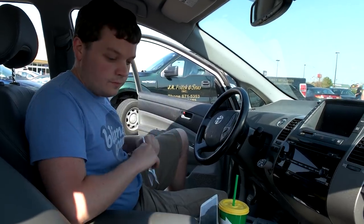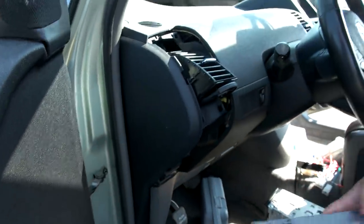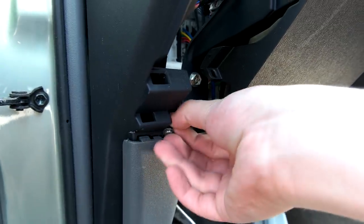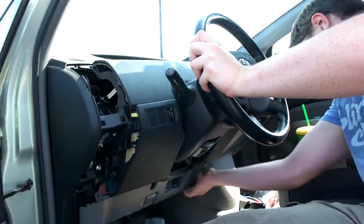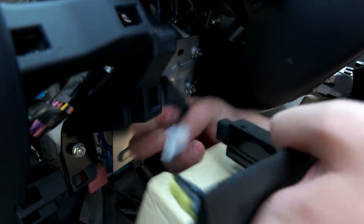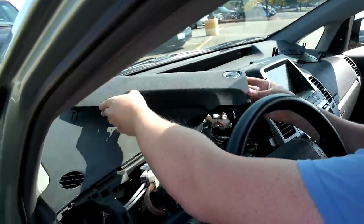Before the old stereo head unit can be removed, we have to pull off the surrounding panels starting with this vent. There's a screw — let's unscrew that. Next is a screw just underneath the steering wheel, which allows the lower panel to be pried off. There's a little tab on the other side. That's the tab I pressed down on. I believe we can just leave that dangling. Let's take this part off — one more up here — and we can set that aside without having to disconnect the power button.